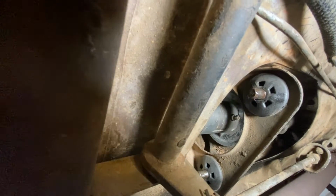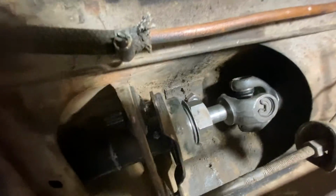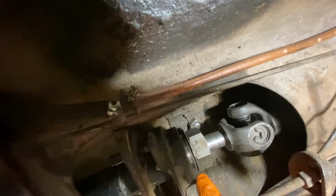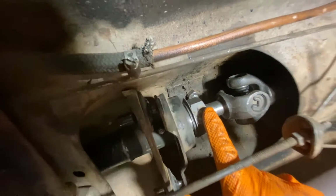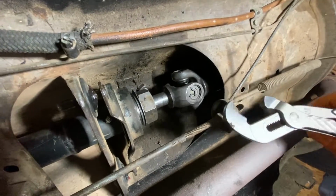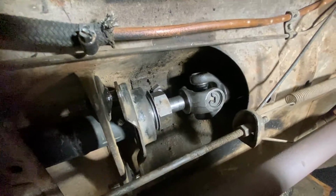So we've got our dust shield in there on the end of the front drive line. We've got our bearing in here. There we go. And then we've got that thrust washer in there, and then this little flat washer that I got to bend over right there, and the big nut. And to get the big nut on, I actually used these Harbor Freight Icon Parrot pliers. Worked amazingly well. I couldn't believe it grabbed that. I didn't even have an adjustable wrench big enough for that.